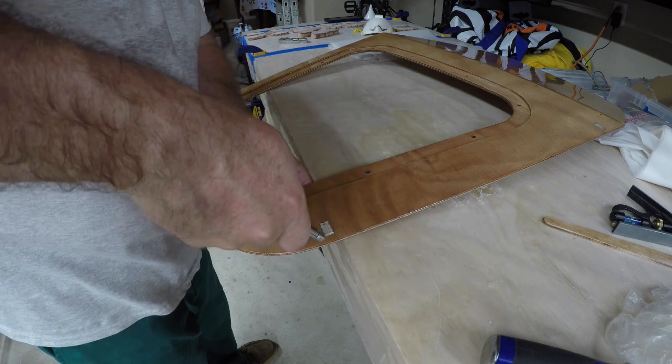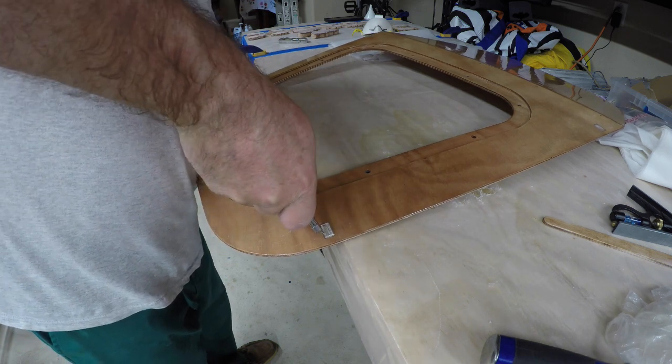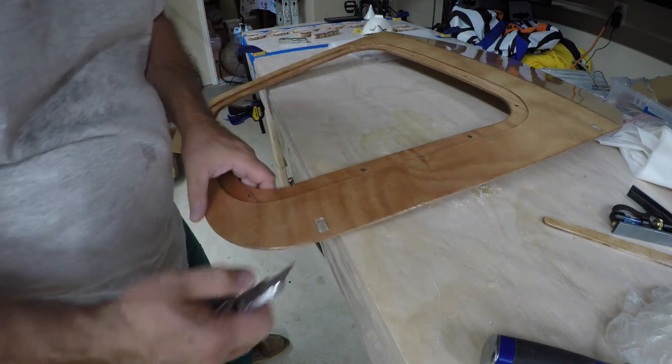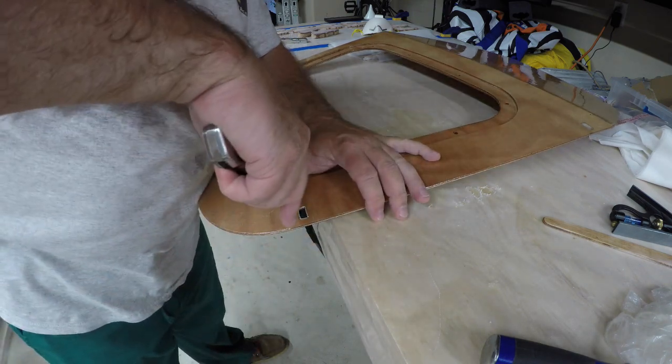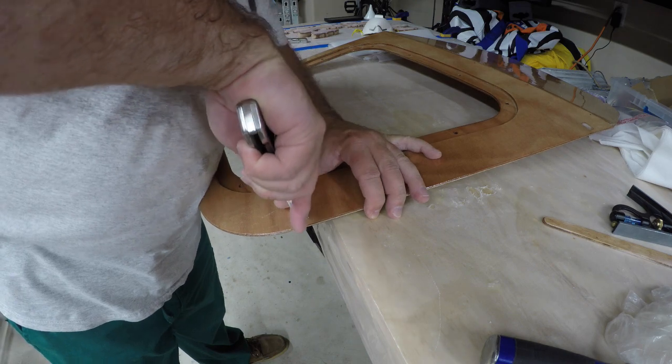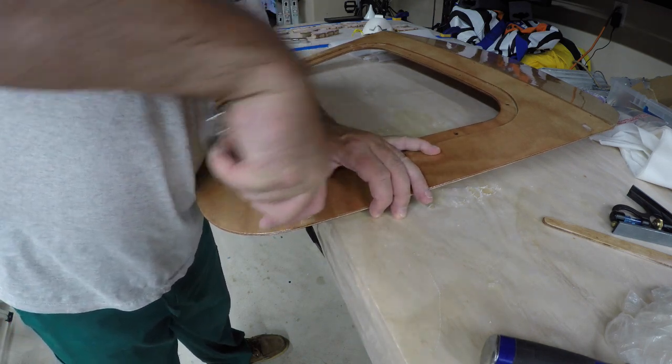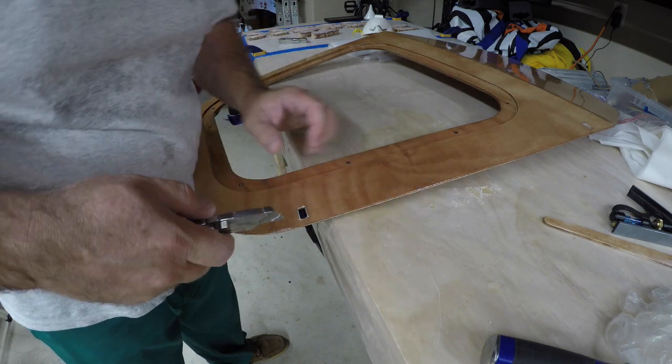When you're putting the hinges on the camper, the square holes need to be cleaned out. There are two tabs on the wooden hinges and they sit inside the little holes in the body of the camper that you have fiberglassed and epoxied over. And in some cases, they are also filled in with the thickened epoxy you use to install other parts, such as the door sills.